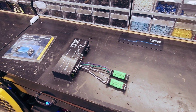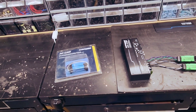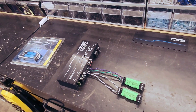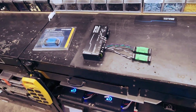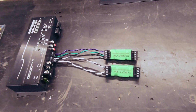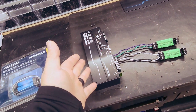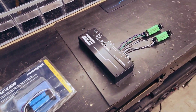The reason I talk about the alternator like that is because amplifiers can do the same thing — mainly Class D amplifiers. Some of them, and this is what's crazy about our industry, you just don't know. It gets to a point where you just do it on every car because you don't know if the car has this problem or not. Just like the alternator needs to see the battery, the amplifier needs to see the impedance or resistance of the speaker. If you unhook the factory speakers from the factory amplifier and put in a new amplifier, the factory amplifier no longer sees the load of those speakers and will begin ramping up and shooting crazy amounts of voltage through its outputs.